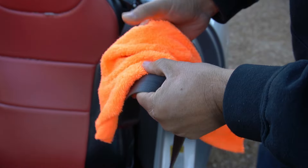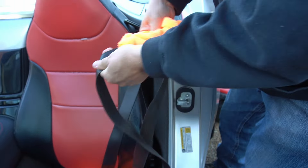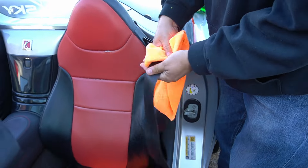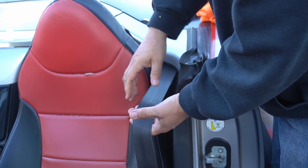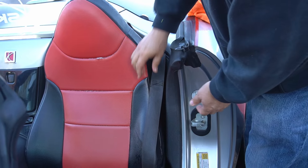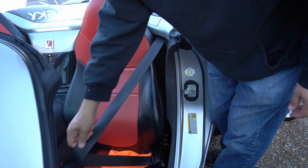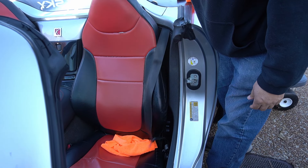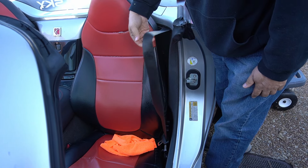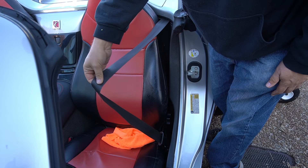You can already see there's some dirt and stuff coming off. About 11 minutes later — I should let it dry a little bit longer but I'm going to see how it works. You can see it's already pulling back nicely. Boom — pulls all the way back. So basically you just have to clean the seat belt off and that should help it retract a lot better than it used to.